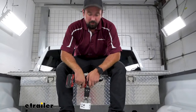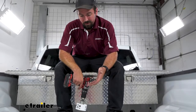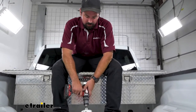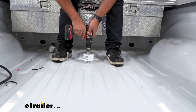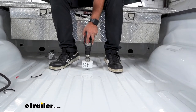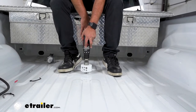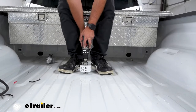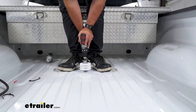With the pilot hole made, it's easy to make sure we're properly aligned. We're going to be using a three and a half inch hole saw, using that pilot hole to drill through. Take your time — if you have a spray-in bed liner, you're going to be working at it a little bit longer. I highly suggest setting the drill to a pretty high setting and using your feet to keep it in place so it doesn't throw your wrists around. Go ahead and start making our hole.